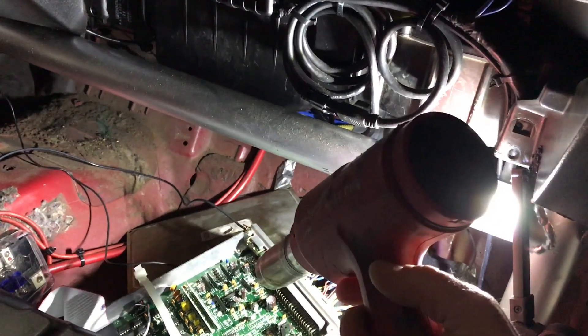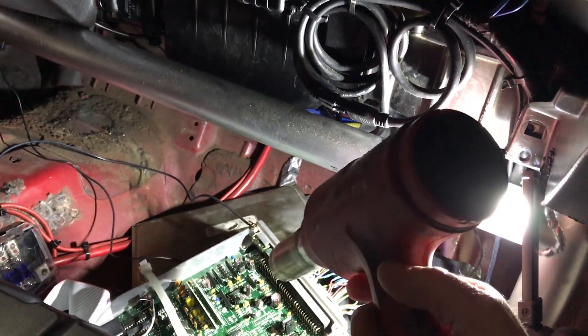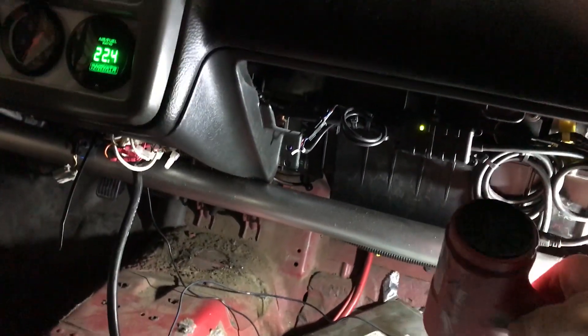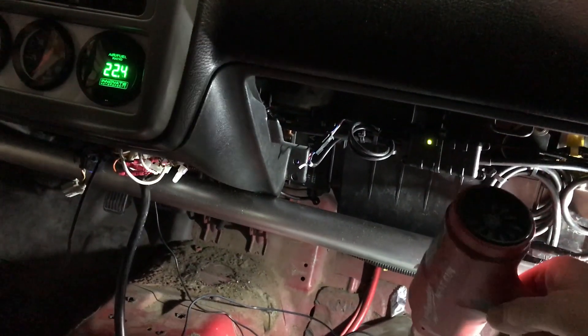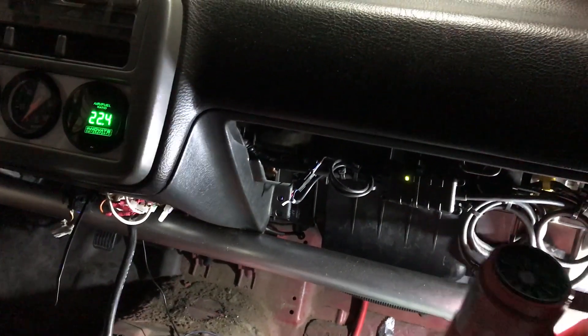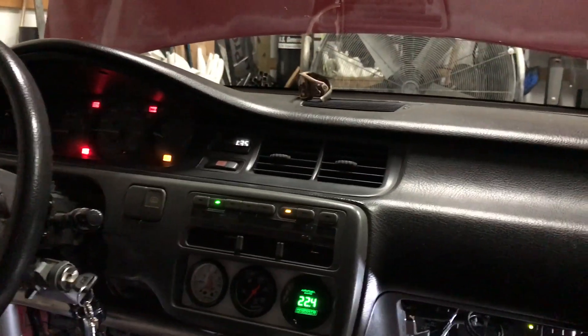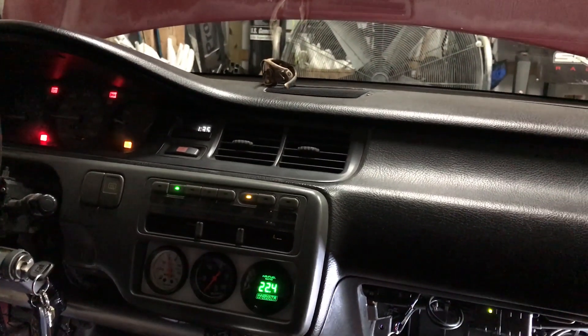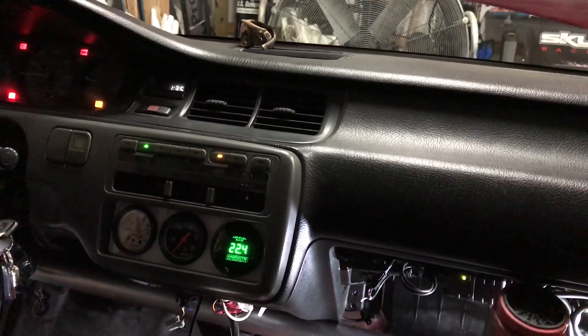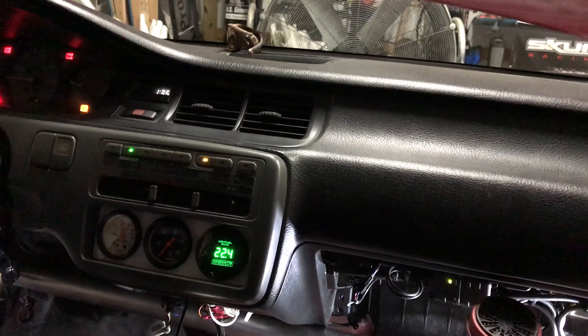I connected a little heat to this and found that during the summer months it would always work, but winter months it would always have problems. So you just apply a little heat to this thing, and after about 45 seconds the car will crank every time. Don't get the heat too hot or too close to the board — you could use a hairdryer for this. Right now it's winter, which is where it really becomes the big problem.